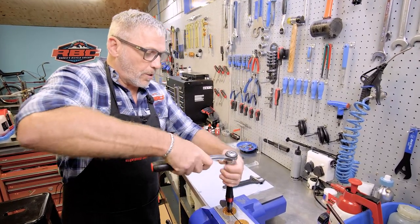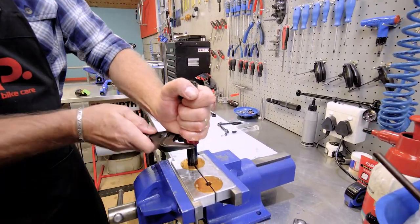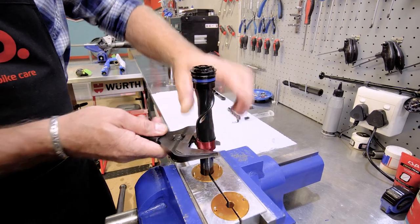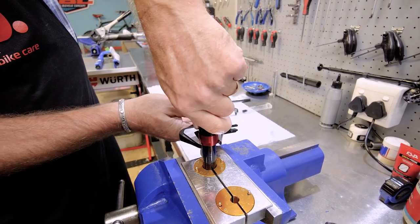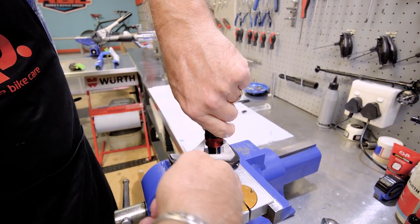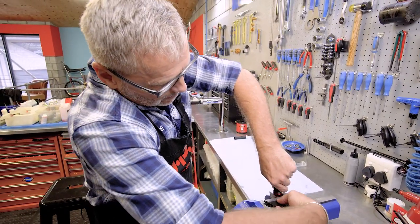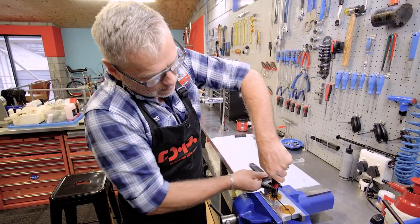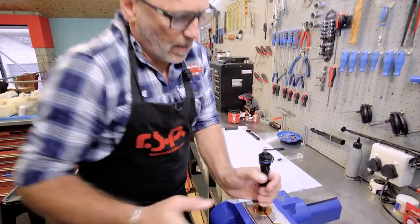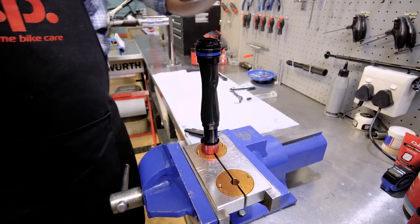the bladder will twist because it is connected. So sometimes it doesn't work 100%, so I'm going to open up from the bottom. This is a 25, or if you just use a shifting spanner, you'll get it. Just undo that while you hold the damper bladder. Just want to take this off the U cup. There we go. Okay, so the U-cup is now free. And now we can open the top.